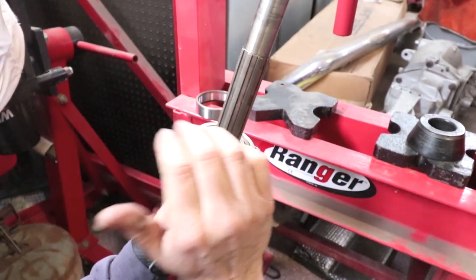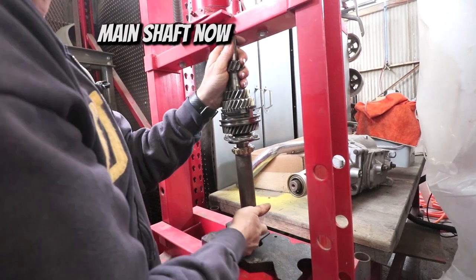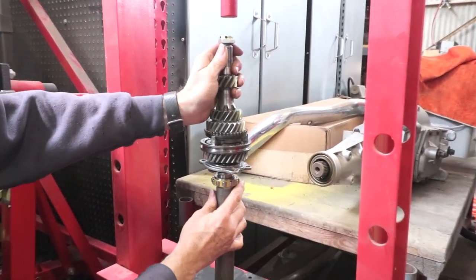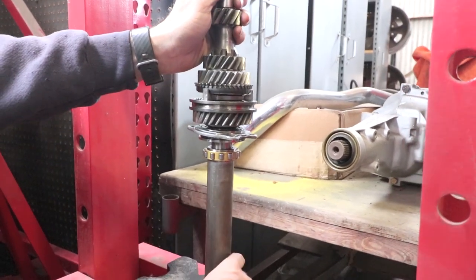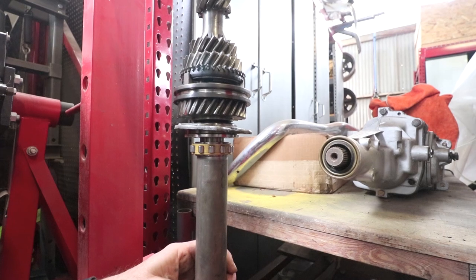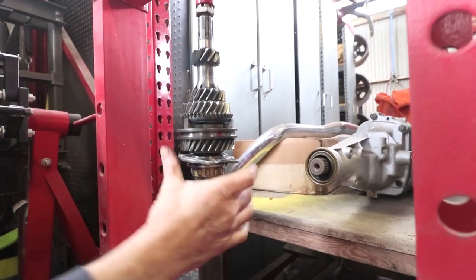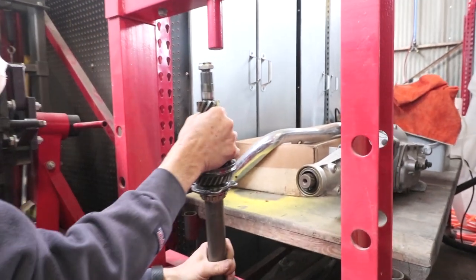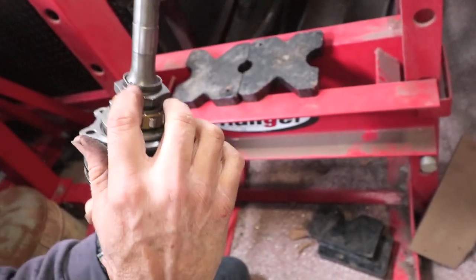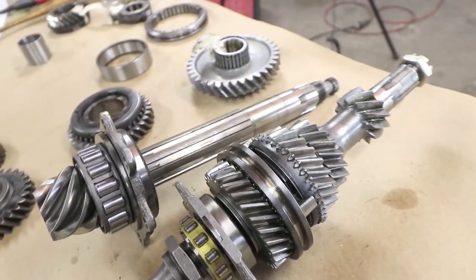The rest of the gears — fourth, third, second, first — that all fits right in there. Last time, this tubing was interfering with the threads, but this is now a larger size tube so this should go right over it. That'll work — we'll get a new nut for that one and clamp it down. I'm going to finish assembling the pinion shaft and then we'll try to line up the gears and make sure everything is in correct position.